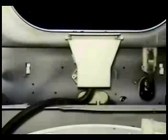To check the internal parts in the washing machine for water leaks, you will need to remove the front panel. If the washer is leaking on the left side at the same time that it's filling, check for a leaking injector assembly, pinholes and cracks on a water mixing valve, pinholes on the hoses, and leaks coming from the filling spout.